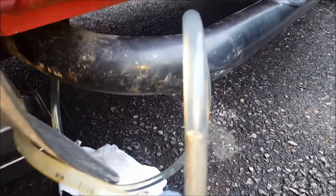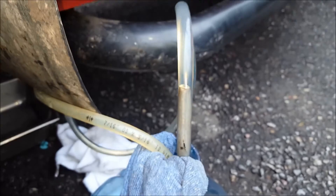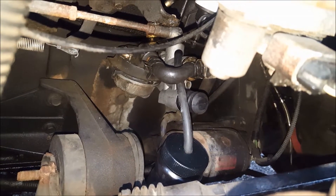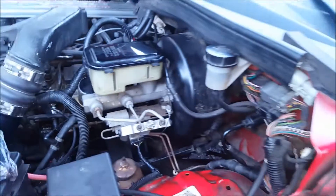I let it run for a bit and we still have air in the line, but our intake line from the bucket is nice and clear. Kind of glad I did this before dropping the tank. We're still getting air in there, so I think my next step is going to be replacing that hose that goes between the fuel bowl and the pump — or at least replacing the clamps — and we'll see what that does.